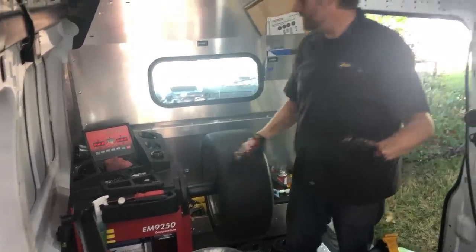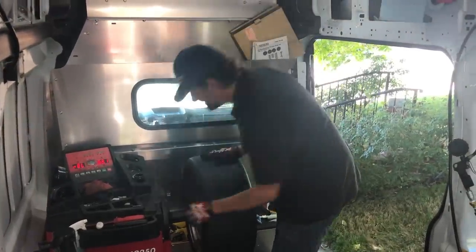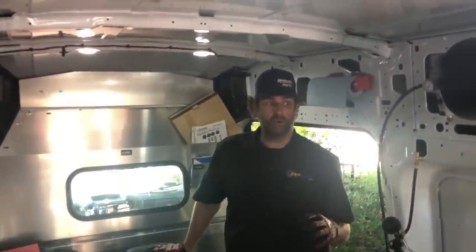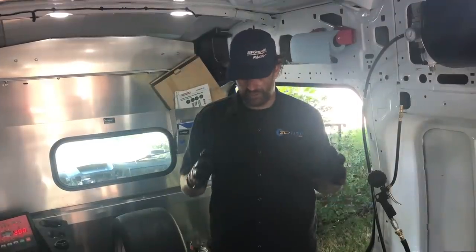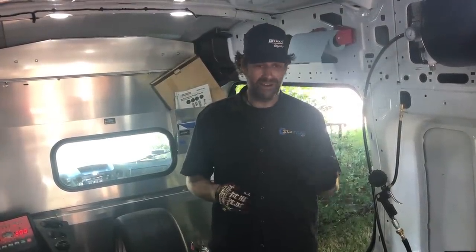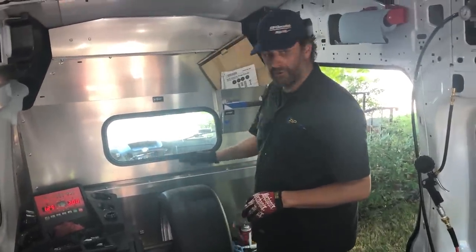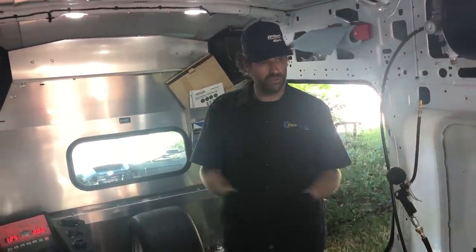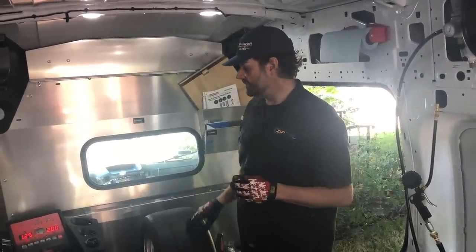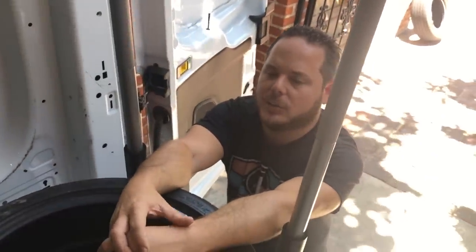The correct method: taper on the inside, then the wheel, with lug simulators on the outside — that's the only way to really simulate what your car does. There are adapters for six bolts, four bolts, and all the different bolt patterns, including eight-bolt. For higher-quality wheels and tires — like a Porsche GT2 wheel with a Michelin Pilot Sport — they're so well manufactured you almost need to put no weight on them at all. Not all tires are round; higher quality tires are more uniformly molded and need less balancing weight. That's why you get what you pay for.